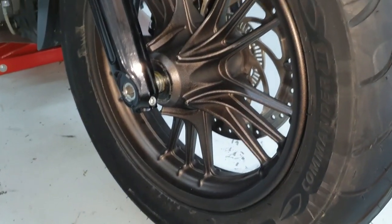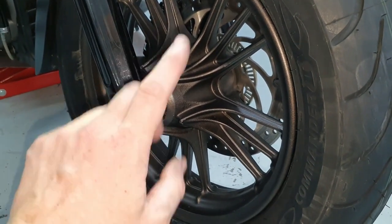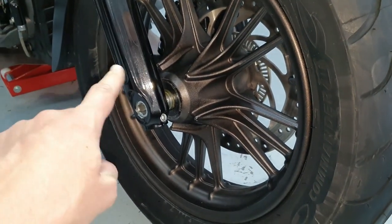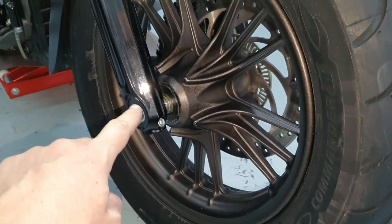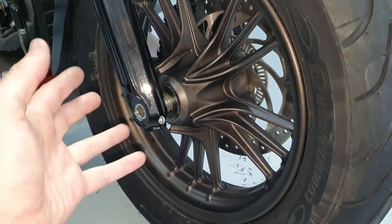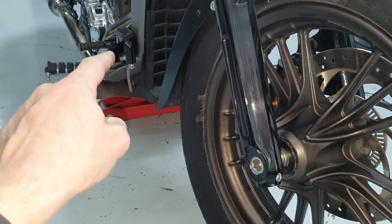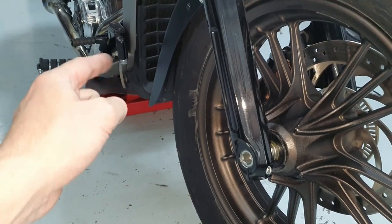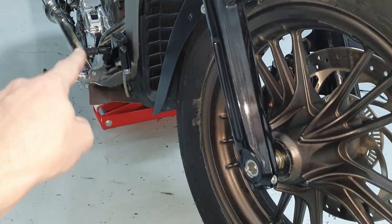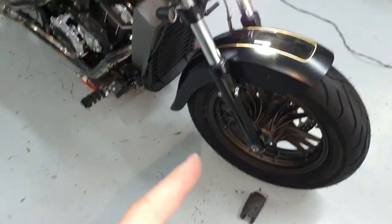Rock solid. What else? SBS brake pads have been put in, and the reservoir, and here's a strange one, the stuff in the reservoir was old, but the stuff in the lines was clear. So this thing must have been standing in UV or I don't know. Also, the cap for the brake fluid reservoir behind the rubber, the paint has been peeling off. So I'm guessing that was painted as well with inferior paint. Replacement online. Right, so that was that.